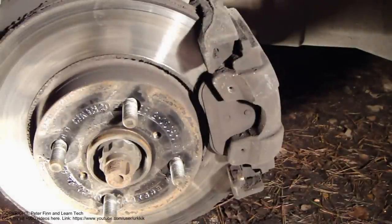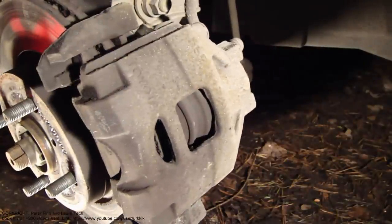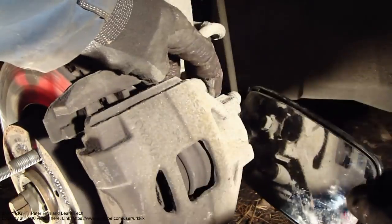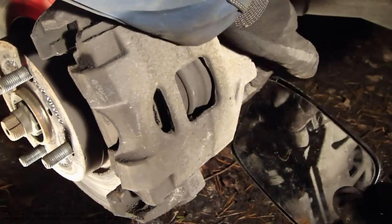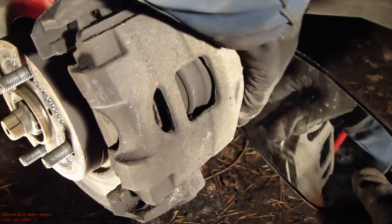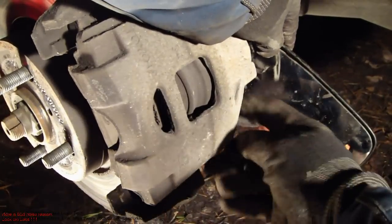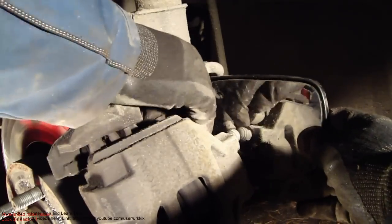And now I went inside the cabin area, and I steer the steering wheel. Now this disc is in the right position. Okay, and then there are those bolts, and they are hidden, so it's good to use a mirror. It helps to look at those black bolts that I am touching now with my finger. There is a plastic cover that we can take out easily using our fingers, and now it's out. There is a deep hole, and this is the cover, and then there are two of those plastic covers, and I take both away using my fingers. Look, mirror.